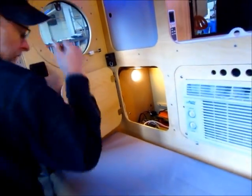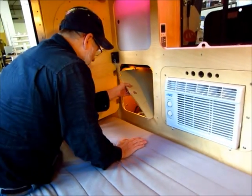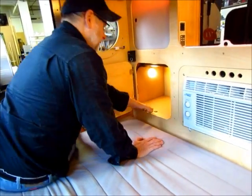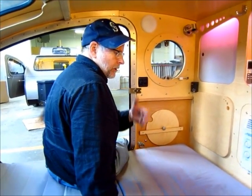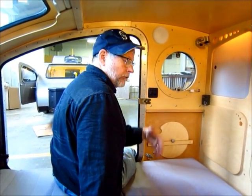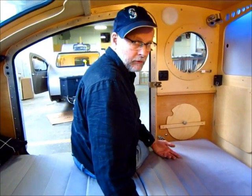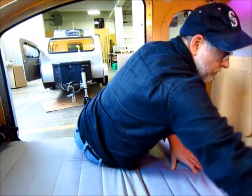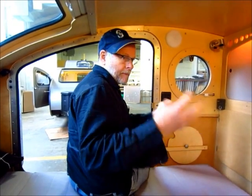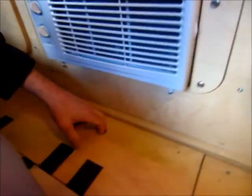And you have a larger battery now. Mine came with a 55 amp hour battery. Because I'm planning on going to a refrigerator - which is the modification you're doing for me, that's why I'm here - you're going to put in a larger battery. What battery are you using now? Normally you'll use a 55 amp AGM battery. But if you're going to be using a refrigerator or the Dometic cooler, you want a more robust electrical system. So you need the larger battery, which is 115 amp AGM. Because AGM is meant to be in bouncy areas and it doesn't off-gas - any position, upside down, sideways. So we can put that in the cabin here.